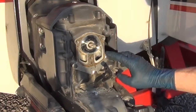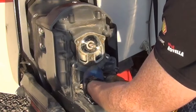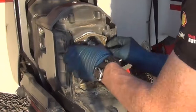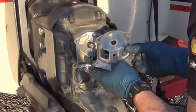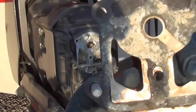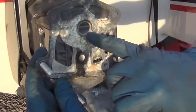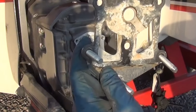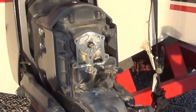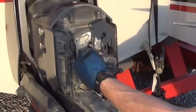Alright, diving deeper into this — we've got three more bolts, again three-eighths inch. I can't think of a lot of ways to make this a better design other than using the metric system. Pretty sweet setup from the mechanic's perspective. You can see we've got the gasket on the back there. The gasket has had a little bit of corrosion that's caused it to get a little weaker. An important note: pay attention to which side this is on. There's a bypass that needs to have flow — you can see on this side there's also a port there, don't block that, water needs to get there. I like to use Permatex Right Stuff on just about everything. I've had fantastic results with it. It does two things: it helps prevent passage of water where it shouldn't go, and it also helps prevent corrosion almost like a paint coating.